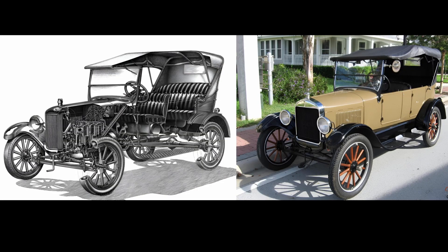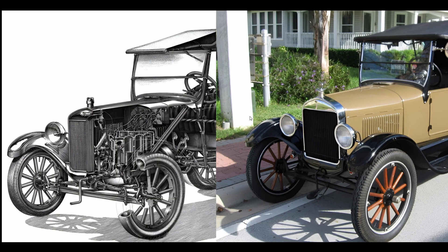When you compare this 1926 Model T Touring to the supposedly 1925 Model T Touring that Mr. Inomoto illustrated, you will see that the bodywork is a direct match. As we zoom in, you can start to see the curved lower windshield, which appears in both the photograph and the illustration. The shape of the windshield pillar is the same, and one of the most significant similarities is the continuous crease line from the base of the window pillar out to the top of the radiator. These are all distinctively 1926 and not 1925 features.